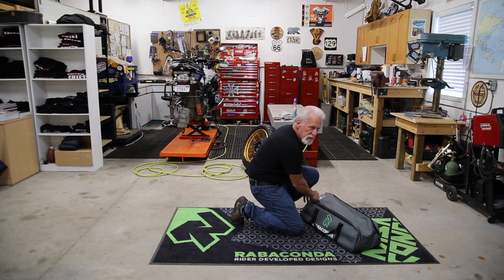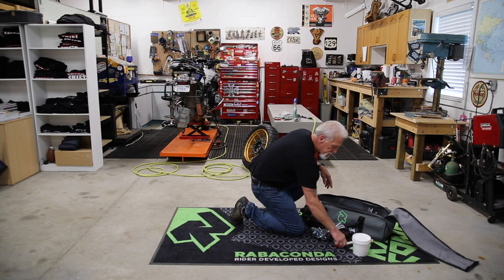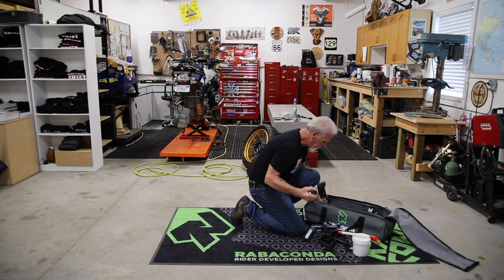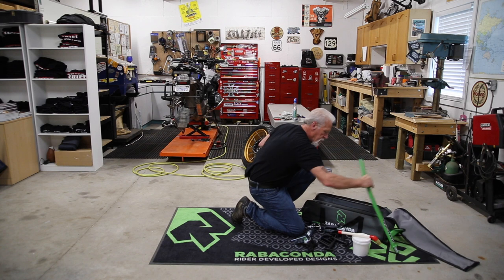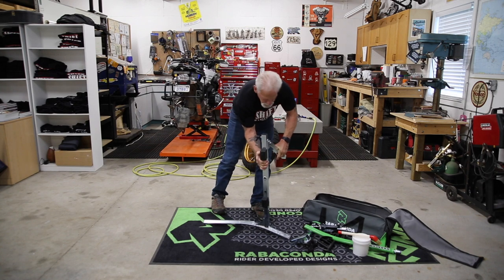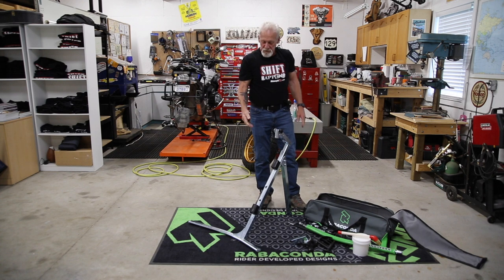It all comes in this carry bag so it's easy to move around. This kit is the starter kit. It comes with grease, a grease brush — those are two accessories I bought after the fact. It comes with two centering tools for your tires to go in the drop center, the duck head, standard duck head, the strap, and the machine itself. It sets up in a couple minutes — everything you need to change tires very efficiently.